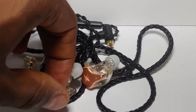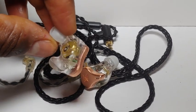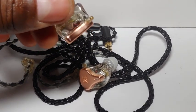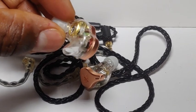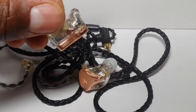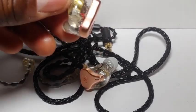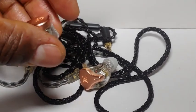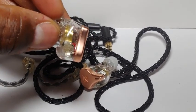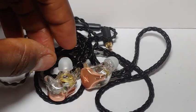If you look in here, you can clearly see there are multiple drivers. You can see one large dynamic driver, and if you look to the side, you'll see another dynamic driver there. The shell is transparent, so it's easy for someone to break it open and check where the wirings are set up and what's working. What ended up happening was that a reviewer who likes opening up IEMs broke it open and found out that only one driver was working and that KZ had cut corners.